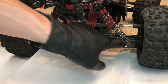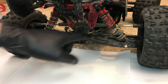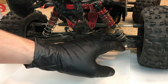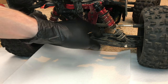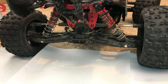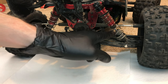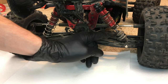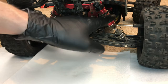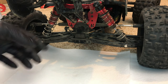It's easier also if you take the shocks off - the bottom shock mount - to actually get those diffs to pop out from the dog bones. Also, I need to undo right up here the front sway bar, or the front part of the sway bar for the rear. You can see right here, another thing that happened - I don't know if that broke or if it just came loose, but I think I lost a lot of shock oil out of this rear shock the last time I ran it as well.